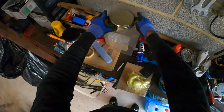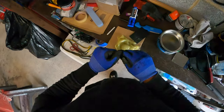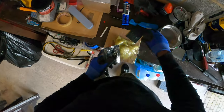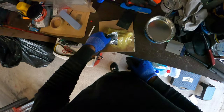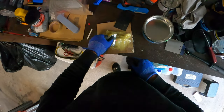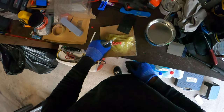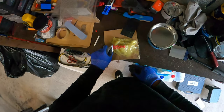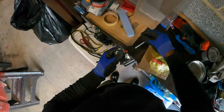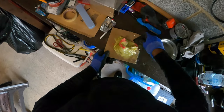All right, put this here, I'm gonna throw this top back on here. All right. So I got the hardener right here. But typically I'll just take it and go from half of the filler and then come back this way. I'm putting a lot because it is pretty thick and I want to make sure it dries fast. I'm not trying to sit here all day messing with this. I know you guys are probably like, man, he's putting a lot of hardener on there. Yes, I am. All right, so I'm gonna take this, mix it in.